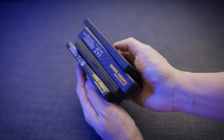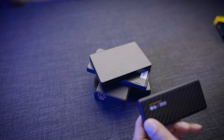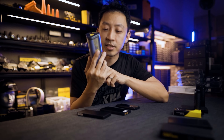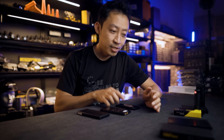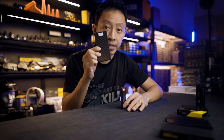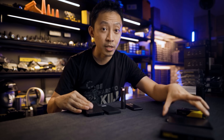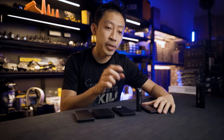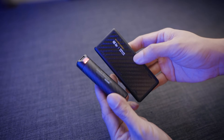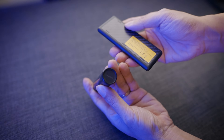How does this compare to other Nitecore power banks? Nitecore only makes carbon power banks and doesn't compete with mainstream brands like Anker or Xiaomi on biggest capacity for lowest price — they go for the highest energy density per gram, which is why all materials are carbon rather than heavy glass or aluminium. Quick lineup overview by weight: NB Air at 89g, Carbon Battery 6K at 88g, NB 10K at 150g with 10,000 mAh, Pocket 1000 at 160g with 10,000 mAh, and Carbo 10K at 179g. Comparing the NB Air and Carbon 6K as the closest in size, weight, and price: the Carbon 6K is cheaper, cylindrical, and slower at 10W charging, while the NB Air is thin, card-shaped, charges at 18W, and is better for slim carry.